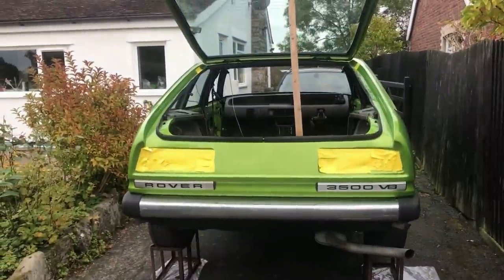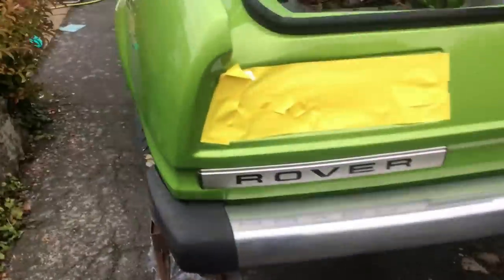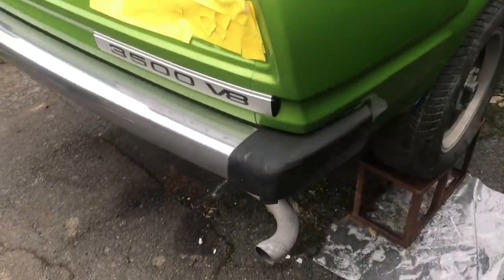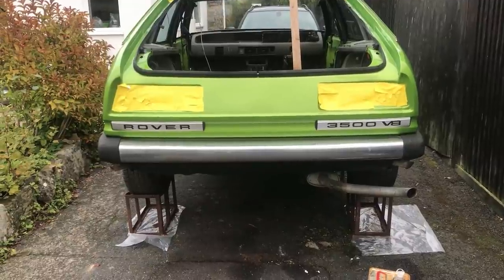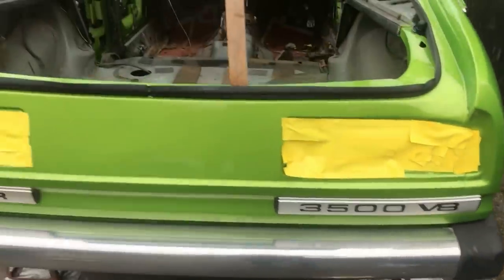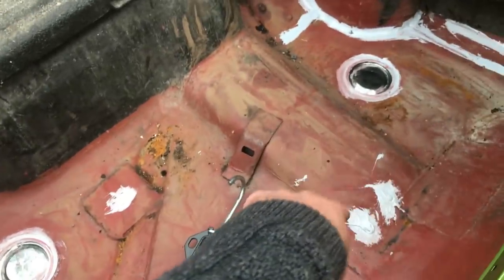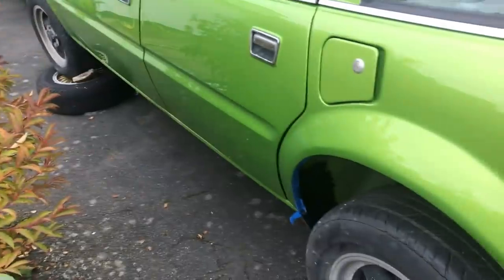Dotty progress: the owner came around today and we did fun stuff like fitting badges and making up one really good rear bumper from several crap ones — a bit of a fiddle but the end result is a really nice bumper with no creases or twists. We've gone for the larger series one-and-a-half script for a V8 Rover rather than the V8S model. Inside I've just done the final seam sealing, put the drain caps in, and sealed a couple of little holes. Next time I can roller the boot floor and the sills.